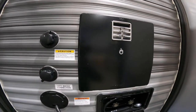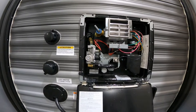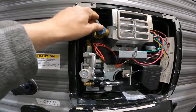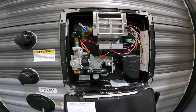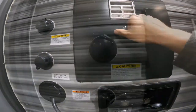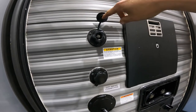In between your slides you have the back of your hot water tank. To drain your hot water tank you always want to make sure you let the pressure off the system first. You can do that by opening your pressure relief valve at the top of the tank, or go inside and open a hot tap, and then you can take your plug out after all the pressure's off. Just at the top beside the back of your hot water tank you have your black flush for your black tank.